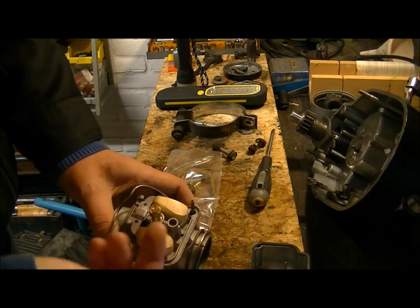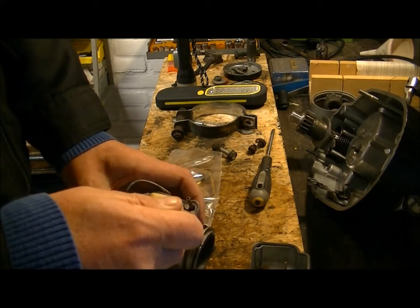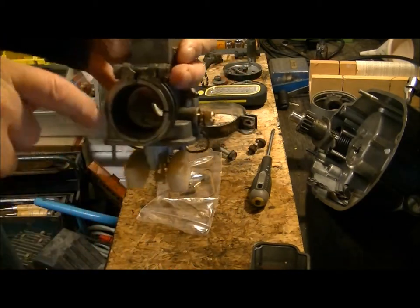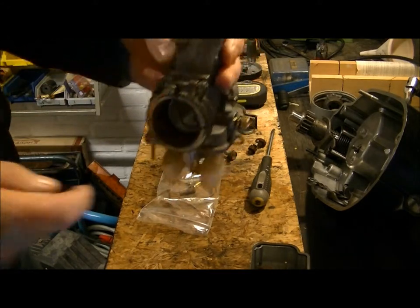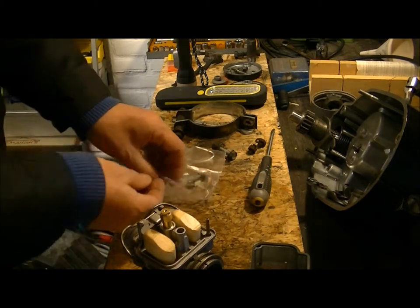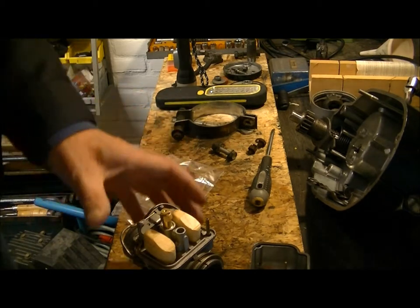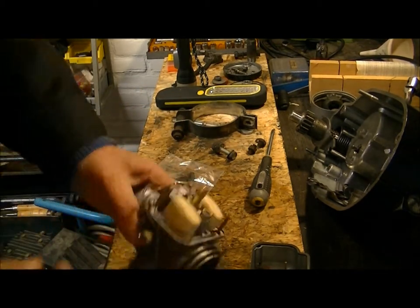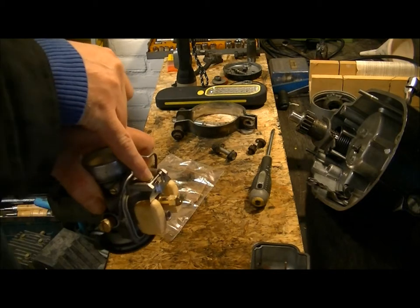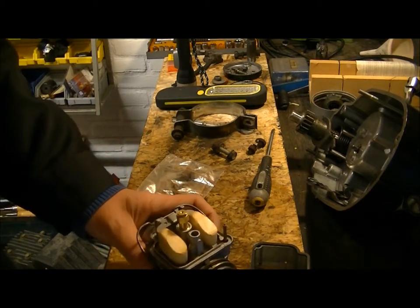So theoretically some petrol might have flown by way of the idle part into the main chamber, opening out at the front side — possibly another cause of too rich a mixture. Unfortunately, I wanted to have the float valve replaced, but they sent me a wrong type of valve — it was too small and I couldn't adjust it in the way it should be.